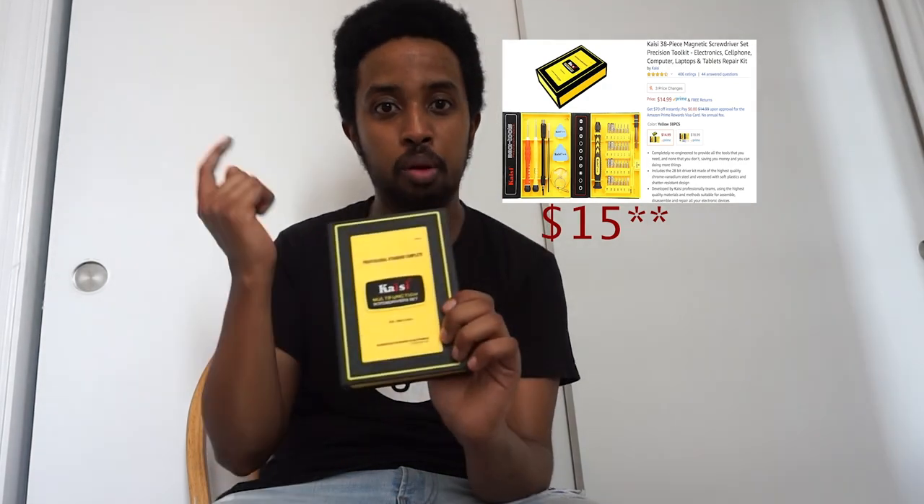I'll put a picture up and link it in the description. The screws on the outside and inside of the PS4 are similar to the ones on the iPhone, so that's why you need the iPhone repair kit. You'll also need a Phillips screwdriver to take out the power supply, which is held down by Phillips screws. Next, you'll need some isopropyl alcohol — I have 70%, but a lot of people suggest using 90%; the higher the percentage the better. You'll use this to wipe down the interior and exterior.